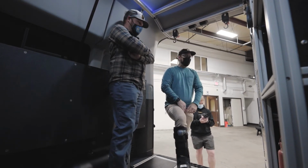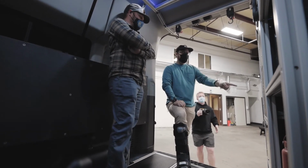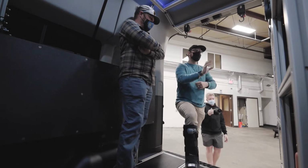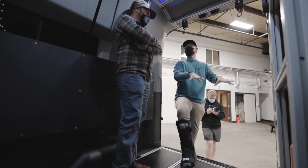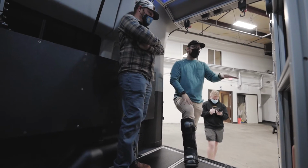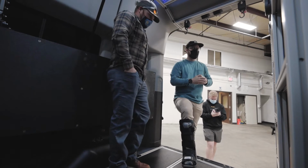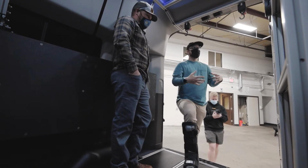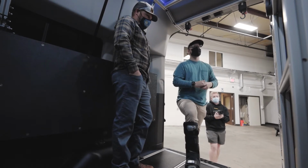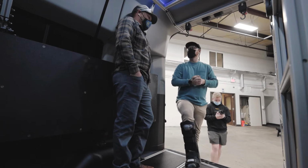It's pretty slick. That's a new thing, isn't it? For the AGMs? No, we've had this. The new thing is we have a cutoff for overall voltage, so you won't hurt the batteries. But we've been using this charging relay for a long time. It's what a lot of marine applications are using for dual battery setups. A lot of the camper van stuff is marine components, since we want that kind of shock resistance and extra waterproofing. Exactly.